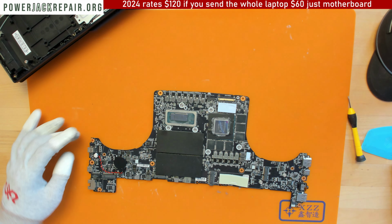All because the solder points are not, let's see, that's the old, oh wow, they made it so fat. Yeah, no, the design was great. I mean, they made the pin fat, meaning they knew it's going to conduct a lot of electricity, just the solder point wasn't soldered from the top, because there's no way to solder this connector from the top. But because I have a soldering iron, and unlike a machine, I can solder it from the top. I'm sure this repair is going to last much longer than the original.